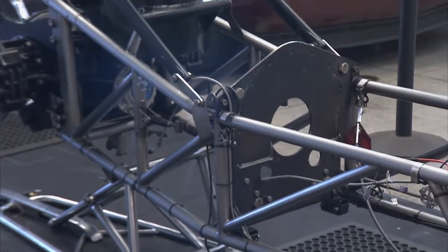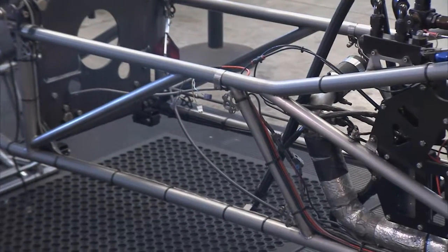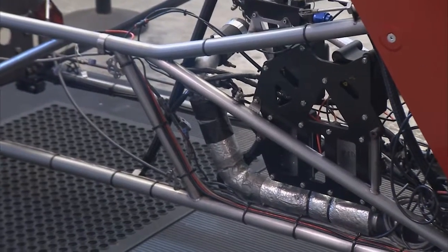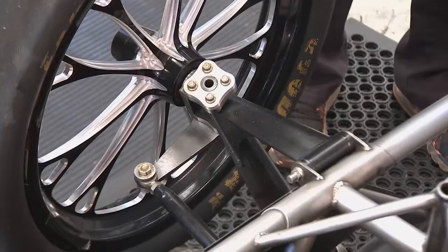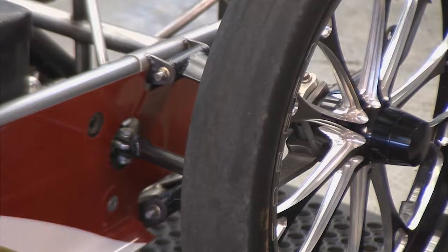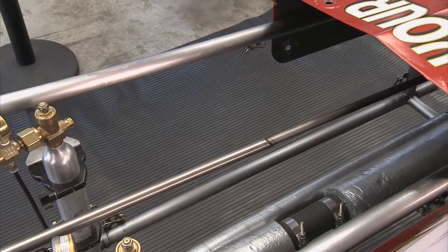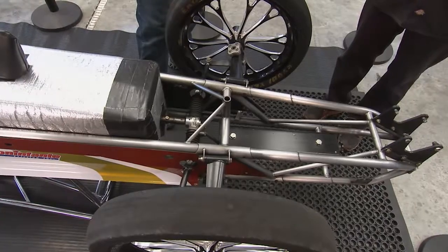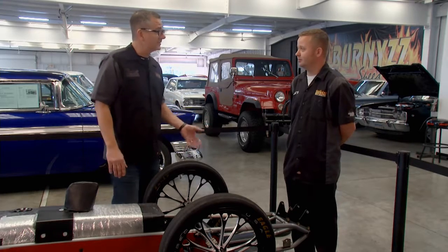This car doesn't have a suspension. It's all about 4130 chromoly, which is what the chassis is built out of, and the chassis flexes. When you launch from the start line, the car actually transfers weight by flexing the chromoly on takeoff — your wheels are staggered, that's how much twist you're getting. And when you stop at the other end, if you try to stop too fast, the chassis absorbs it by bouncing — that's your suspension built into the actual frame of the car.